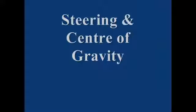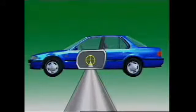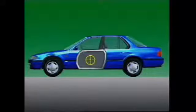Since both front and rear tires develop a slip angle in a turn, the vehicle's path is determined by the steering of the front tires and the slip angles of both the front and rear tires. These slip angles depend on the location of the major components. The center of gravity is the balance point of the entire vehicle. Its actual position depends on the location of the major components, and it is always located above the road surface and between the tires. When a vehicle is cornering, this is the point through which all centrifugal force is assumed to act.